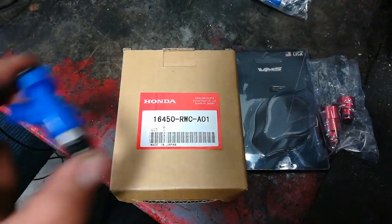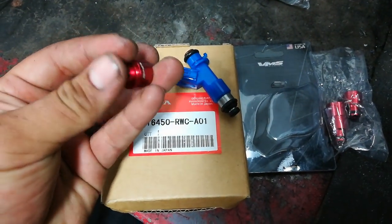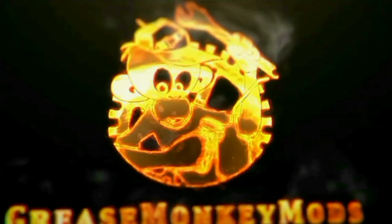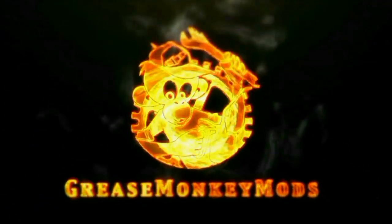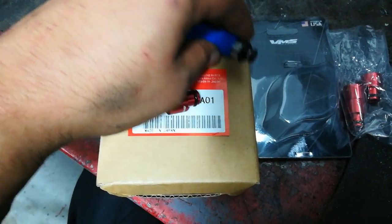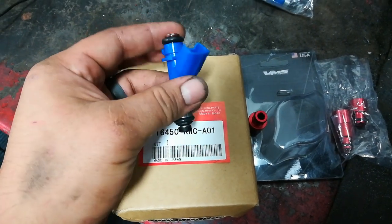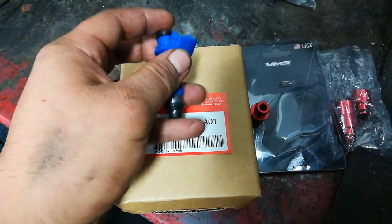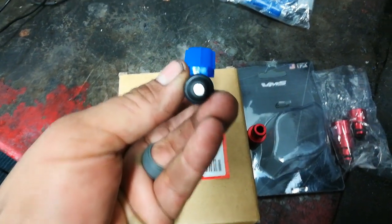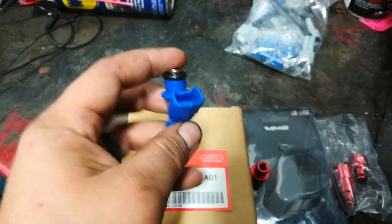Welcome back to another video. Today I'm going to be installing factory RDX injectors along with the VMS racing adapters into my D16 Y8, because the RDXs come with a turbo K series, which need a lot of injector. These flow 440cc compared to the stock 240cc. And I believe they have 8 holes, which should atomize fuel really good.